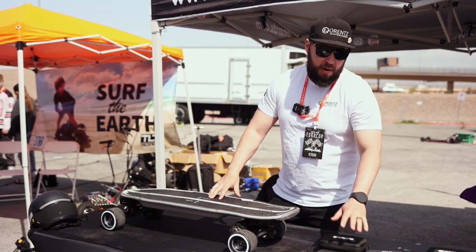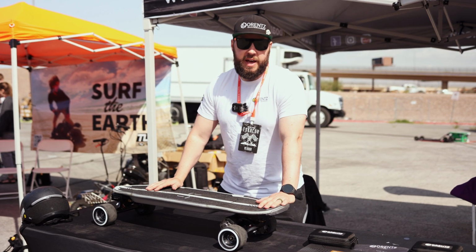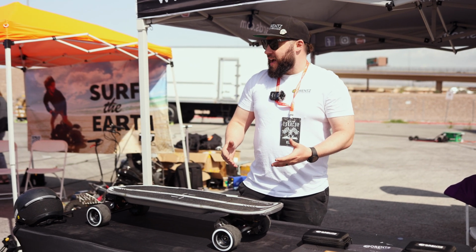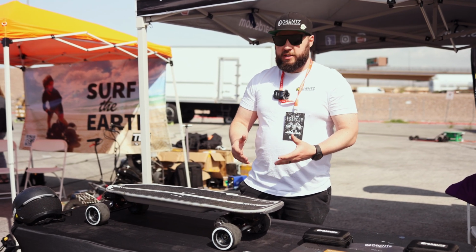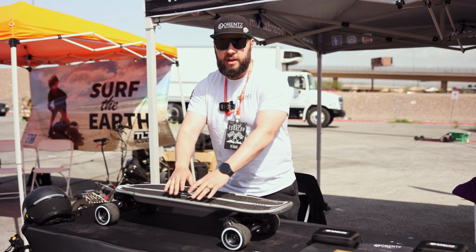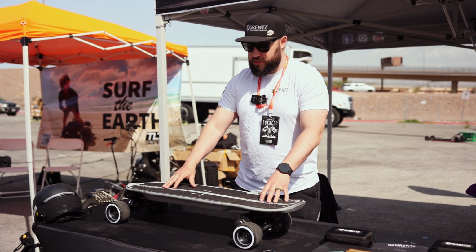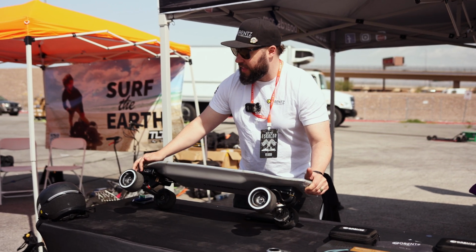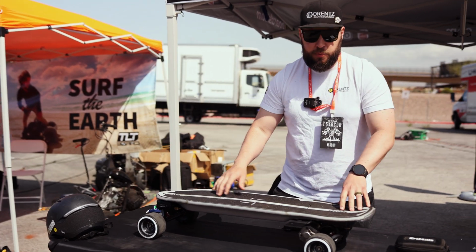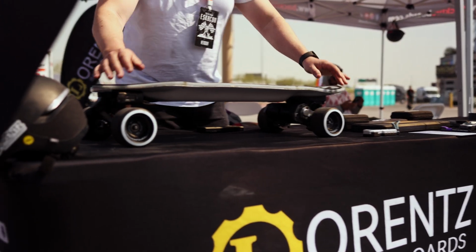It does that using a Molicel P45B battery. We're able to crank out a lot of amps from a 14S2P battery. We've tried to pack a lot of features in here, so not only are you getting this major performance, but you also have an LED light strip that goes all the way around it. You can adjust it to any color in the remote, as well as a series of patterns. We've also got the same headlights that are on the Major itself, which are 2,000 lumens each. And then the Pro version is going to ship with these 105 boosted style wheels on it.